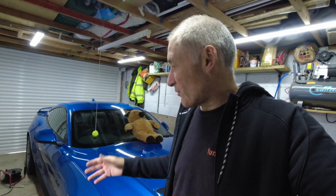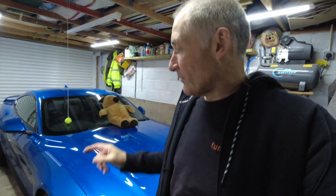So I said before, these were Steeda Jacking Rails. A little bit disappointed that they didn't just fit perfectly on the driver's side. I did have to drill them, as you saw. But after that, they fit perfectly well, and they're all now installed, and they're absolutely fine. Now, you do get a load of bolts with the kit, but those bolts are quite short compared to the ones that I took out from the car, so I've just used the car ones. I don't know if you're supposed to replace the car ones with the ones you get, but the ones in the car are twice the length, and I think they must be there for a reason. I'm not sure what those bolts are, but I'm keeping them that long, so I'm not making them any smaller.